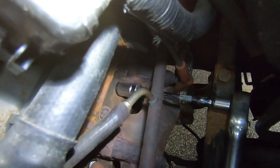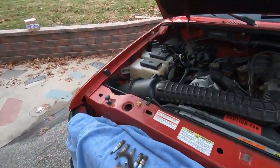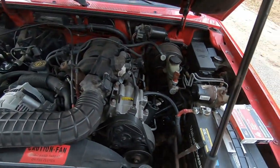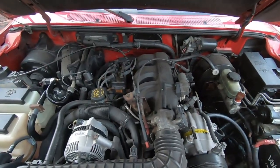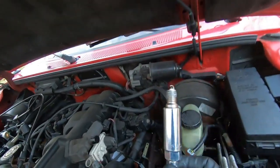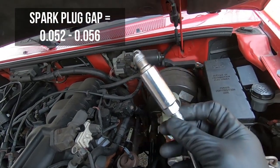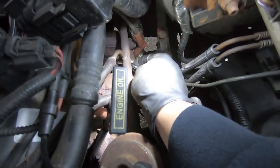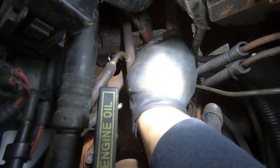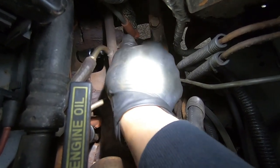Last plug is out here. Going to put it with the others, prep our new plug and get that in — and we'll have all six plugs in our 4.0 V6 replaced. Putting our new plug in with the four inch wobble extension setup just how we took it out. This was about 55 on the gap, got the littlest bit of anti-seize on there. Going under same way I took it out, getting that thing started, finger threading it in — and I think I got it, yeah it's in.